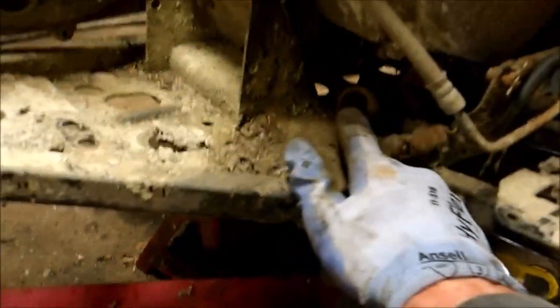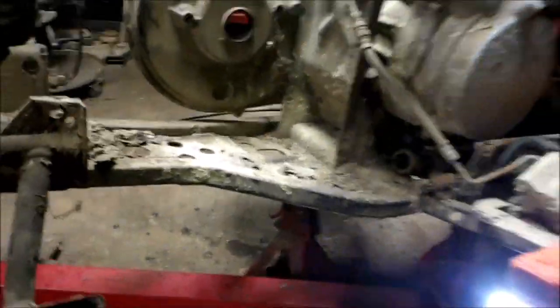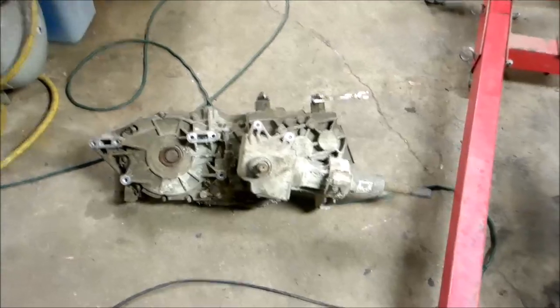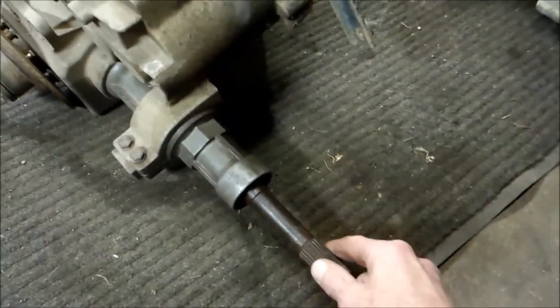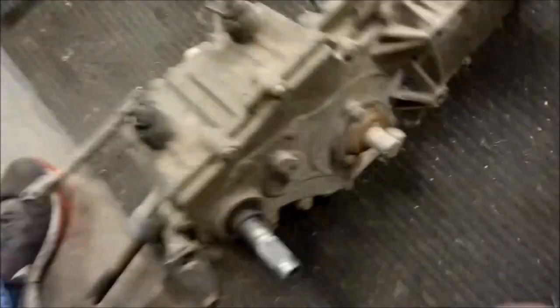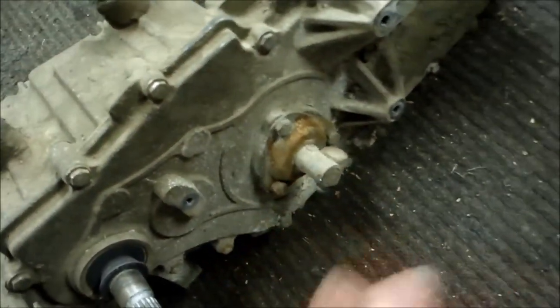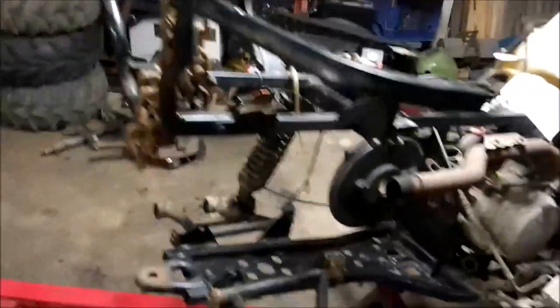I got the transmission pulled. Here's the shaft that comes off the transmission and here's your front drive — basically I had to get that shaft out of that socket, so I held the transmission, used my persuader, and knocked it a couple times. Now I've got the old transmission out and I'm ready to put the new tranny in. Best thing to do is get these really clean and then put some grease on there — that should slide right into the front drive shaft. I'll pull the speedometer cable bracket and put it on the new transmission before installing it.